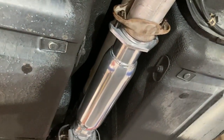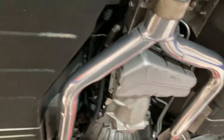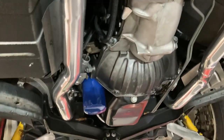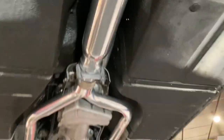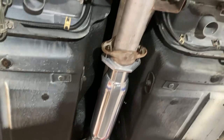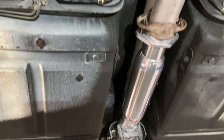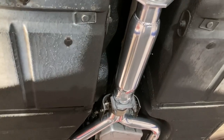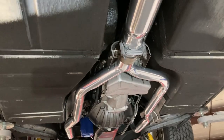That's ceramic coated — we didn't do the back part but it's all polished up. It looks real nice from behind. Over the top there is your factory GM part they call the off-road pipe. Obviously this car's got no catalytic converters. There's a glasspack in the middle — a three-inch glasspack — to kind of quiet it down. It's basically dual into single, then back out to dual. I like it this way because it balances the sound of the motor out and on TPI cars this will actually improve your torque a bit with a big setup like this versus trying to rev it high.